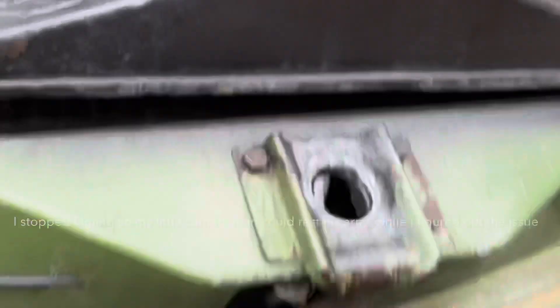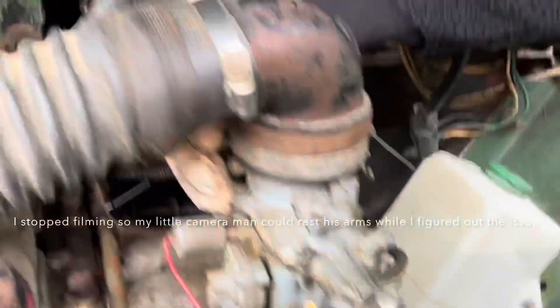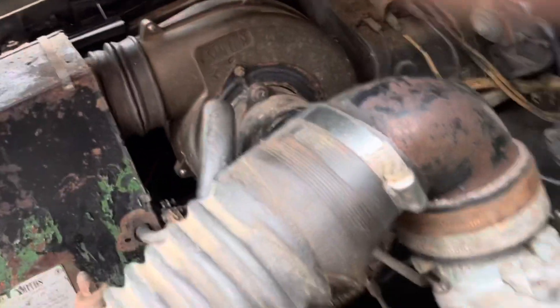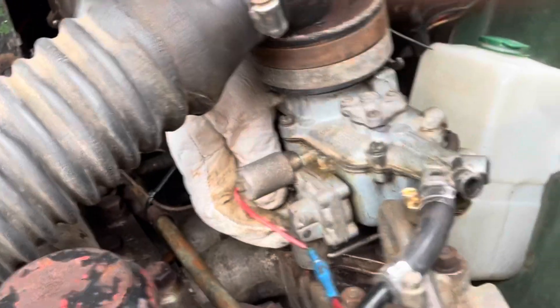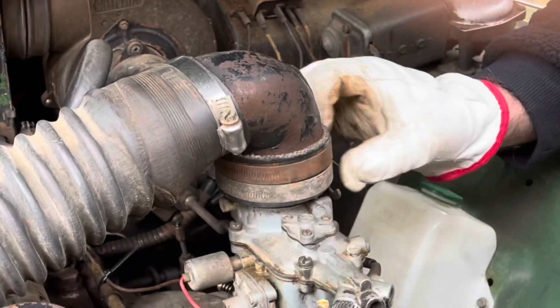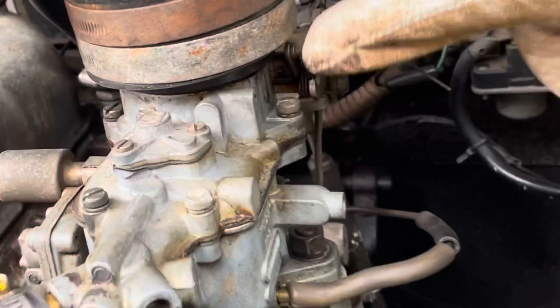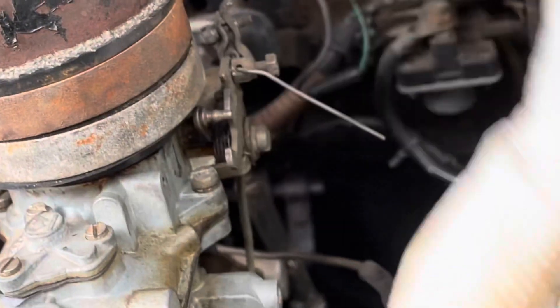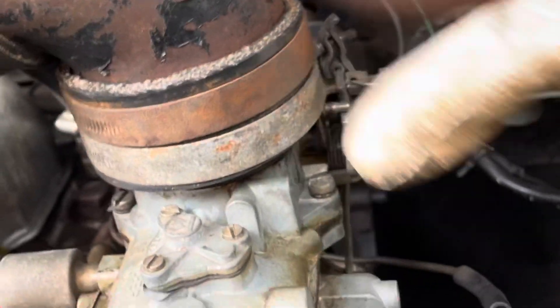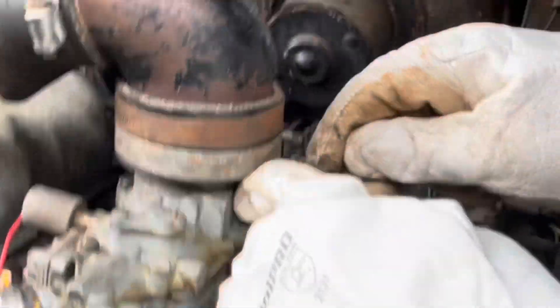It's not starting very easily this time. I'm not sure why — I think it could be to do with the carburetor tuning itself. Smells a bit funny. And also I have this spring missing. This spring here should be holding this in the backwards position and it's missing. So I might try and wedge that in there somehow, because that shouldn't be moving back.